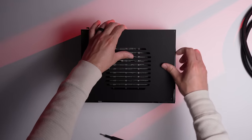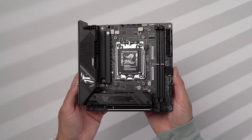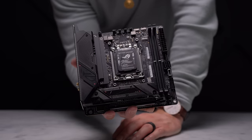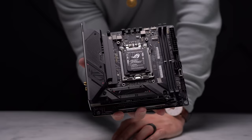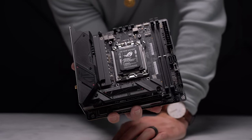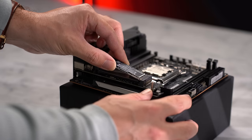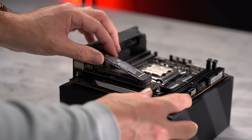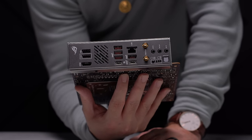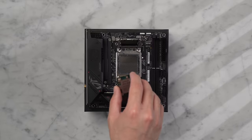For the motherboard I'm going with the ASUS B650EI. I've used this board in a few builds now and it's probably my favorite AM5 ITX board. I really like the all-black understated look. It has large and quiet VRM heatsinks, two M.2 slots with the front one being PCIe 5.0, a great selection of USB ports including two USB-C, built-in Wi-Fi 6E, and a BIOS flashback button.